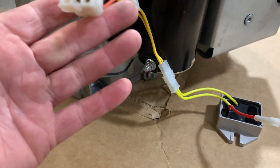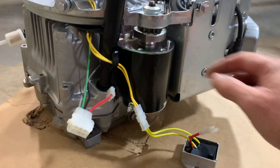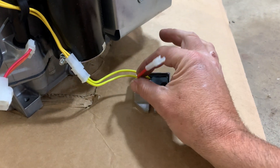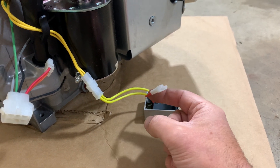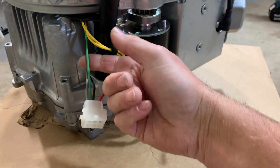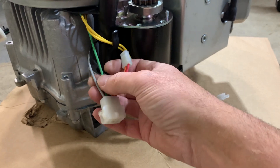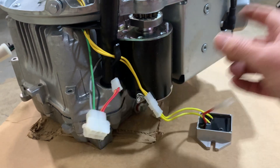I'm not going to use that terminal at all — I'll remove the whole plug and use the existing wiring. When I mount this voltage regulator, it generates 12 volts through the magneto stator, goes through the regulator, and the output charges the battery. I'll rewire so the charging system goes into the original plug, the low oil pressure cutoff wire runs as a separate standalone line, the black ignition line goes into the plug, and the fuel solenoid to the carb goes to the new plug.